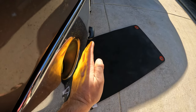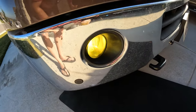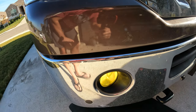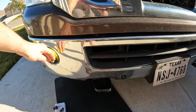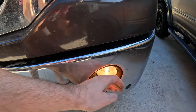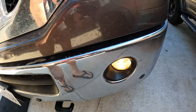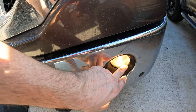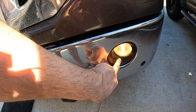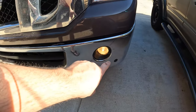It definitely puts out some light — it'll be interesting to see how nice it looks tonight. Another thing: you want to make sure your lenses are relatively clean, as debris will cut down light output significantly. Since it is an LED, I don't feel any heat radiating from this bulb, whereas on the halogen side I can feel heat half a foot away from the bulb. That should give it more longevity. Some people put halogens in small enclosures and end up melting the lens — LED should not cause any fire hazard or melting because it is a cooler light source.